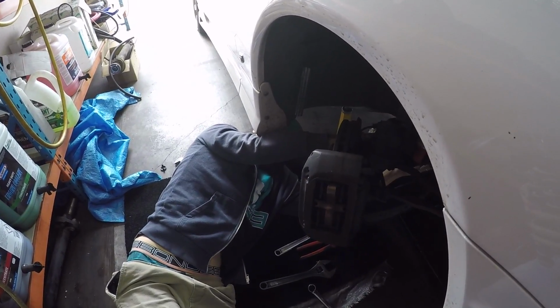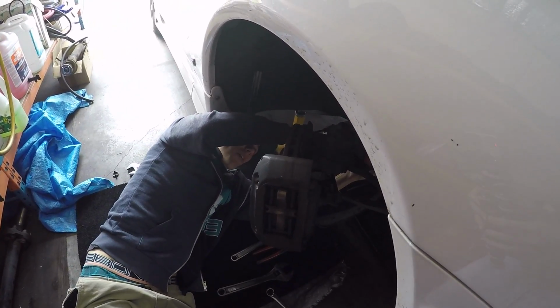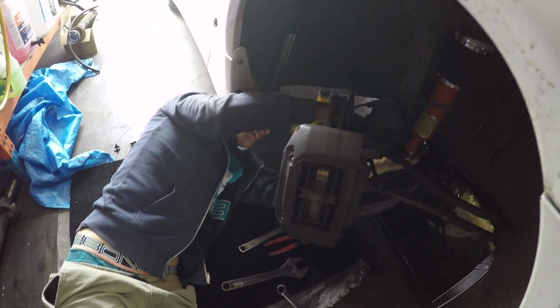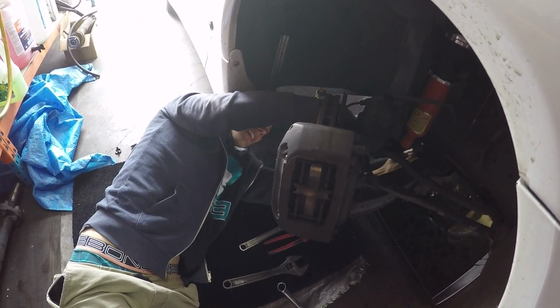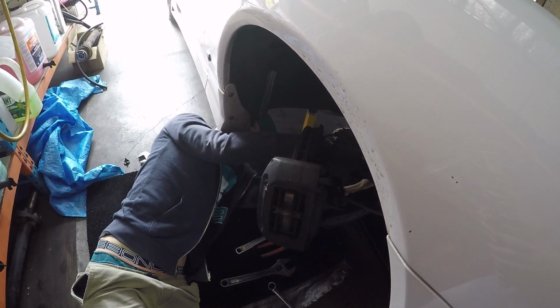We're making Matsuri. So what happened? What happened? Our parts people screwed up. They don't know anything about Skylines here. Long story short, their listing for the four-wheel steer Skyline, the HICAS Skyline, is completely wrong. So I've had to take out this other rack end now because it's too short.